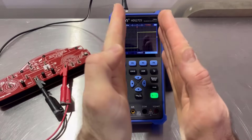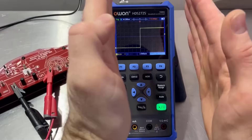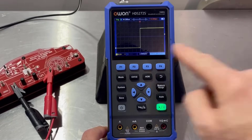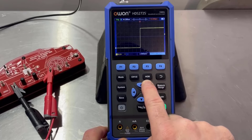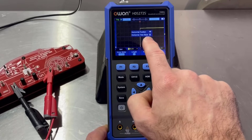So what we've got is it should be a square wave signal — we're kind of zoomed into it at the minute. What we want to do is set that horizontal time base. So we hit that button there — horizontal — and that brings up horizontal position and time base.